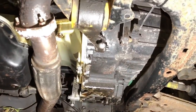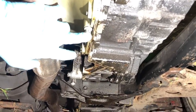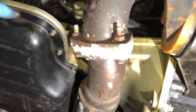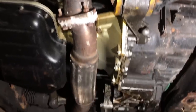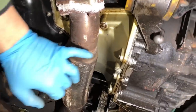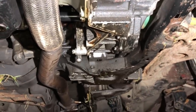The car's up in the air, oil drained from the sump. Having a look at the leak — it's running down here, possibly a rear main seal, but it's also running from the top of the sump around this part as well. So the sump gaskets are leaking and have got to be replaced. We'll pull the sump, change the gaskets properly, and if it's the rear main we'll have to pull the gearbox off. It's been leaking for a while.